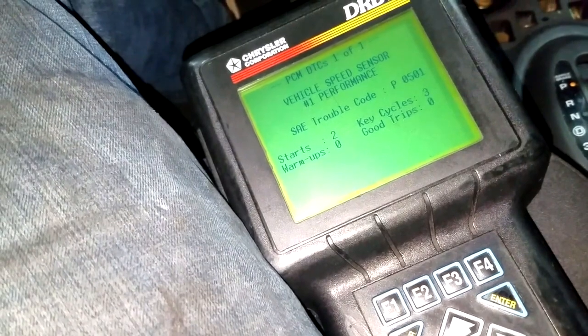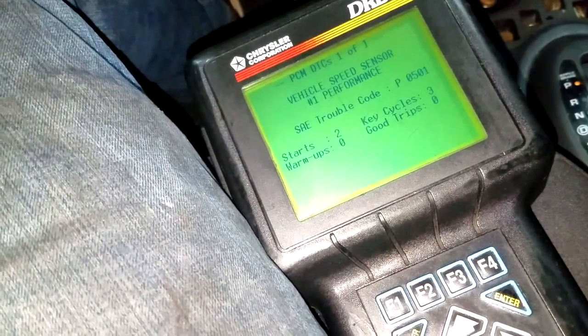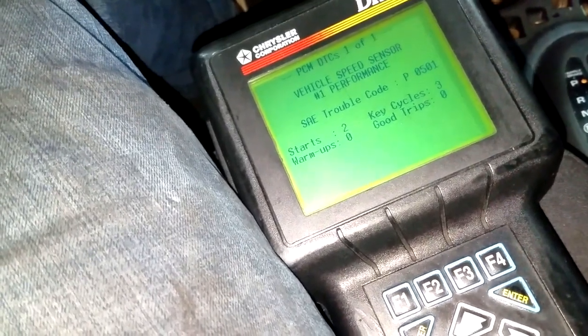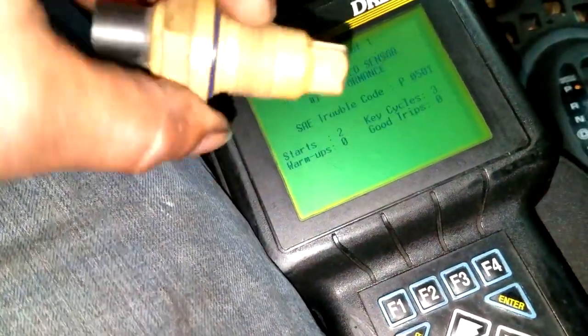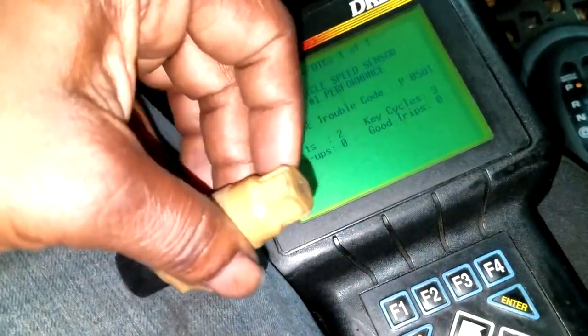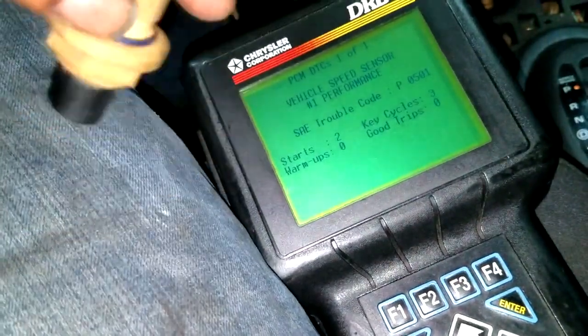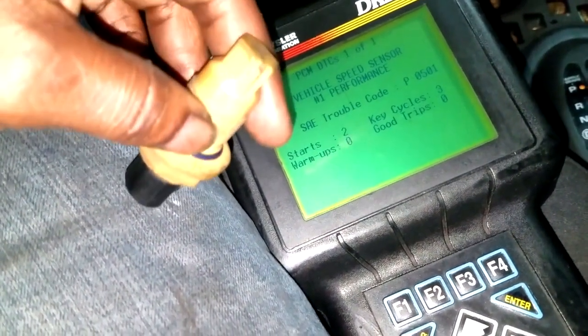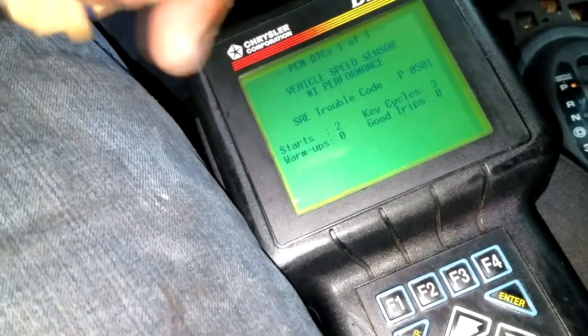No, it's not the turbine, but it's on the input clutch assembly. There's some gear. I have overhauled plenty of these transmissions. That sensor is the input speed sensor. It screws into the transmission and monitors the speed of the input clutch assembly, the hub. The output speed sensor does the same thing.